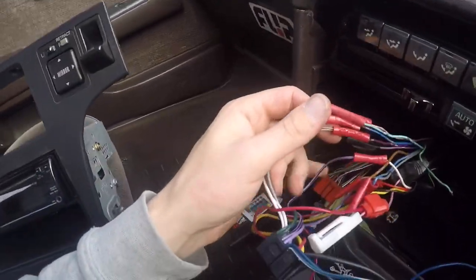What I need to do is figure out which wires do what. In most cases they're color-coded, so you match the purple wire on one harness to the purple wire on the other. Looking at this now though there are some differently colored wires, so I'm just going to copy what the previous owner did. Before I start I'm taking photos of where each wire goes on the harness, and making notes in my phone so I can refer back if anything doesn't work.